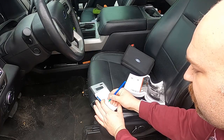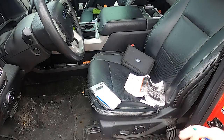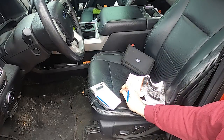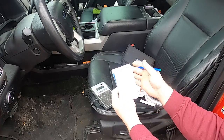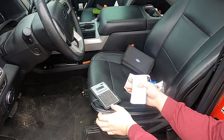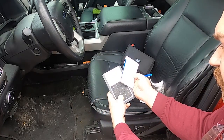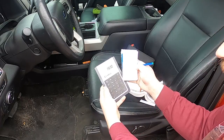So we write down 28,700 pounds. To figure out what trailer I can tow, I take 28,700 — what Ford rates the entire truck and trailer combined to weigh — and I subtract my actual scaled weight of 9,010 pounds. 28,700 minus 9,010 gives us 19,690 pounds. So we know the maximum that we can safely tow with this truck, according to these calculations, is 19,690 pounds. But there's still more you need to check to make sure that's an actually safe number.